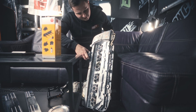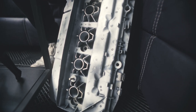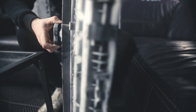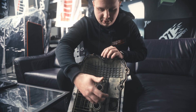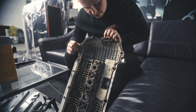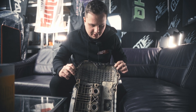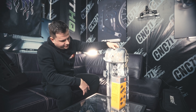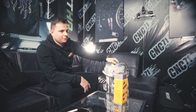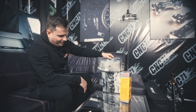Without that it would have real trouble finding where it is. So we measured everything — the gap needed to accommodate the OEM sealing — and we needed the scan to get a brief overview of which geometry to stick with. We also made a 3D scan of the engine bay because we didn't want to have any collisions with our shiny new, expensive billet CNC valve cover.